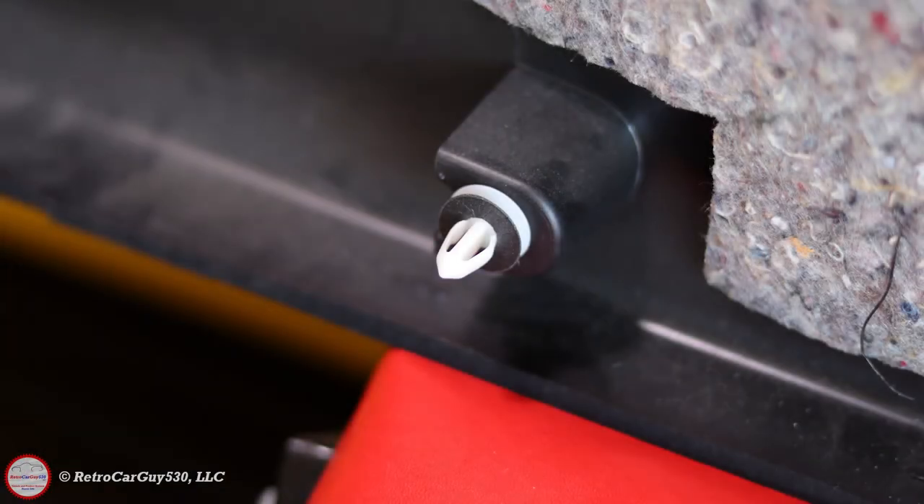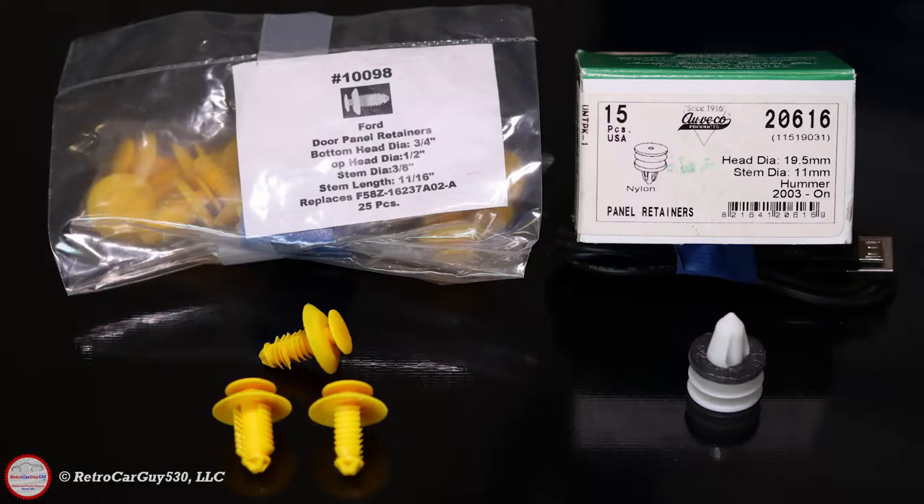Before you install the door panel again, check the plastic retaining clips to make sure both sides of the white ones are present, and that all the ribs on the yellow ones are intact — those tend to be more than single use but not many more than single use. I obtained these particular clips from clipsandfasteners.com, so I'll put a link in the description. The yellow ones are listed as a Ford part but there are equivalent GM parts — these look most similar to the ones I had on the door panel. You should also be able to find these at most any local auto parts store, as they are very common GM plastic retaining clips.